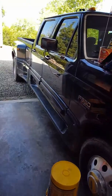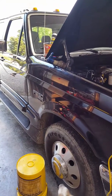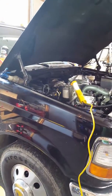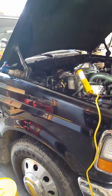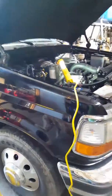And on these big trucks like this, even cab and a half trucks, with the brake systems that are on these things, guys, there is a ton of brake line that you got to get the air out of. And the old deal, you know, okay, pump them up, okay, hold them, and then you crack the valve open and the brake fluid spews out or runs into a container you got underneath there, and you do that 15 or 16 times, pretty good chance you're not going to get all the air out of this system.